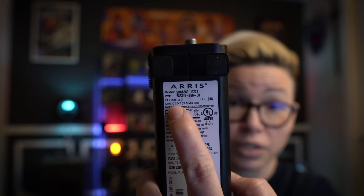For example, my modem is a Netgear DOCSIS 3.1 modem, because in California, Comcast allows me to have access to a gigabit plan. It's not true gigabit — I only get gigabit speeds down and about 40 up — but in order to support that plan I needed a modem higher than the standard DOCSIS 3.0. You can see on the bottom of this older device it says DOCSIS 3.0 and Wireless N, which is very old. Read and know what kind of equipment you're using.